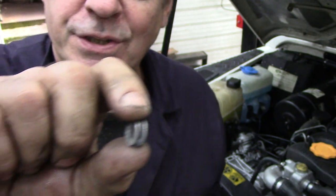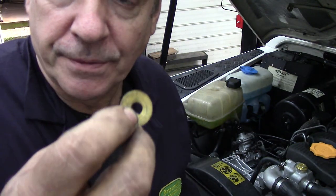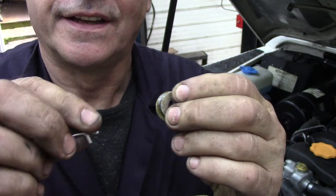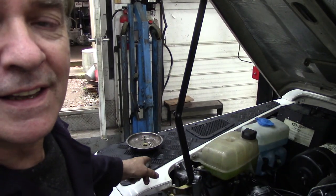There's little split pins, but the problem is I use this double spring thing here which was on the original Land Rovers. You've got a big flat washer against the slot in your prop, then this compressed together, and the pin goes through like a dream if you don't drop it on the floor. Top tip: these little magnetic trays are an absolute godsend. If you haven't got one, a speaker magnet works — you can put all sorts of nuts and bolts on it. There's nothing worse than getting through a job, leaving it a couple of weeks, coming back and forgetting where all your nuts and bolts are.